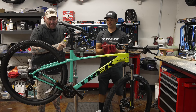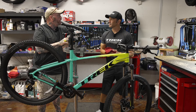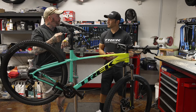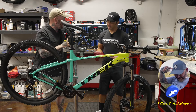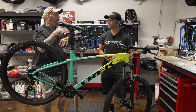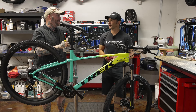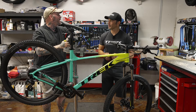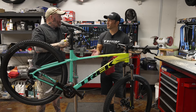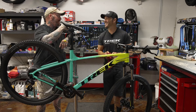That's not a necessarily technical replacement — about $30 in tools, granted you already have a crescent wrench and a three-eighths drive socket. It's fun to do and certainly not like rebuilding a front suspension. It's a satisfying little job, especially when the creak is gone and the play is gone. If you haven't done it before, it might take you a half hour to 45 minutes. Most bottom brackets are throwaways today — there's no real maintenance. Unlike press-fit ones, provided you're careful and methodical, you really can't mess this up too badly.